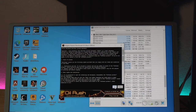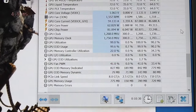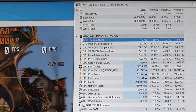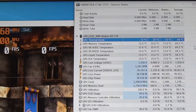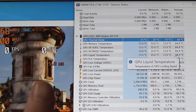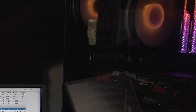Back after right at 10 minutes of running Heaven benchmark. Highest temperature recorded on the GPU: 73°C, average 64°C, currently 72°C — that is perfectly normal. I'm not sure what's going on with the problem they're reporting because I don't see any temperature runaway here. Feeling the back of the PC, there's a little heat but it's actually pretty minimal. This isn't super high-end hardware, and any computer produces some heat, but this is definitely not a runaway overheating scenario.